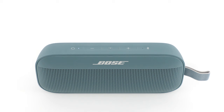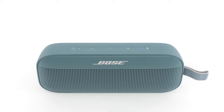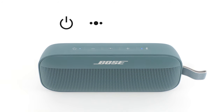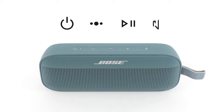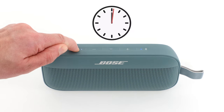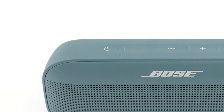If your speaker has a battery, you can press and hold a button on it to reset it. This varies by speaker. If your speaker has a power button, multi-function button, play-pause button, or mute button, try holding one at a time. After 10 seconds, the light on your speaker should blink and your speaker will reboot.